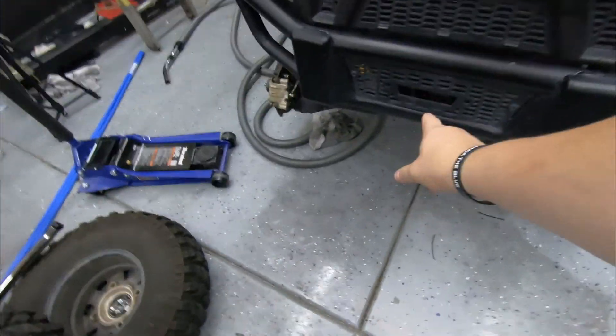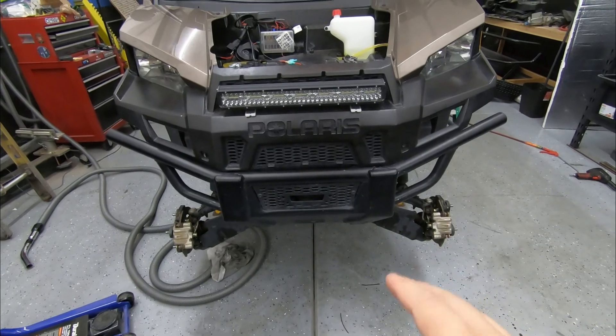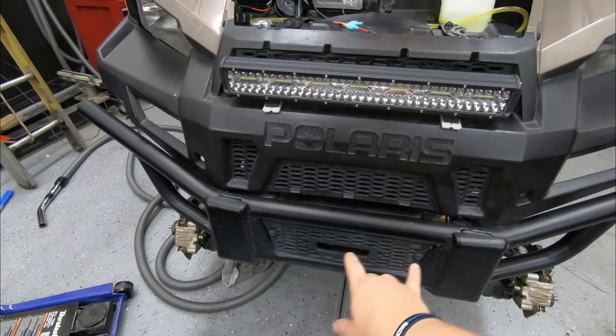What we're going to be doing is installing it in the front — sometimes people install them in the back. I already got the tires off because I changed the brakes in a different episode. First I'll be removing this cover and the bumper to see how we mount it. There's a lot of wiring involved, but for now we just want to mount the winch itself first. Once it's mounted we can run all the wires, and I'll show you a nice easy way to melt the plastic so the button fits in there nice and tight, very professional looking. This is my first time installing a winch on an ATV — all my previous ATVs already had winches — so let's get to it.